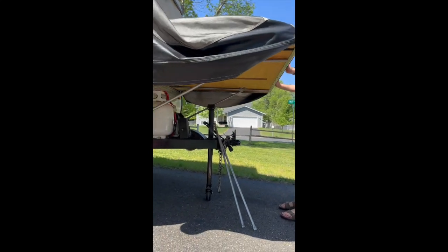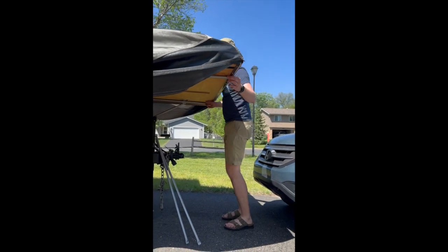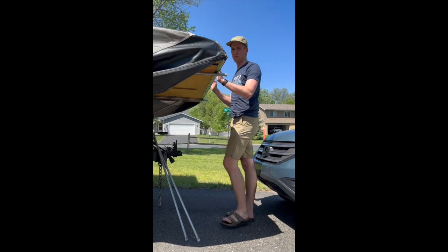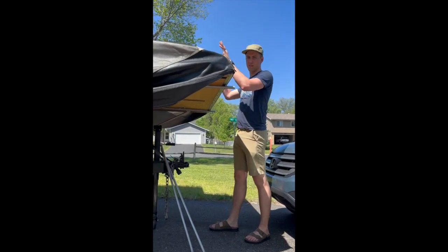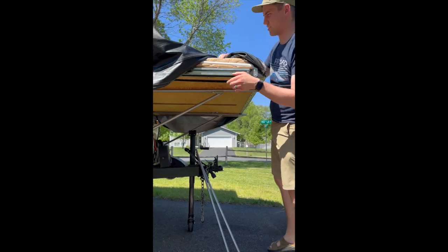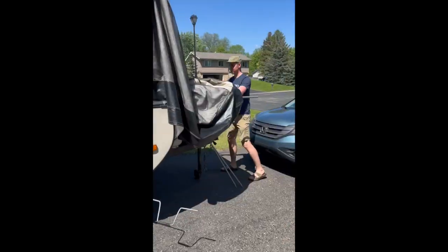We just push straight in. Grab the post here because it gets caught up on a lip, and just get it right over that little bump. The thing we don't want to do when putting the beds in and out is lift up on them, because it'll bend this channel and make it impossible to get it inside its groove, okay? So just start again.